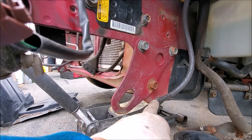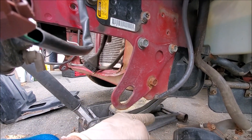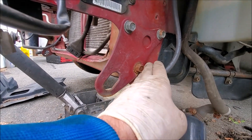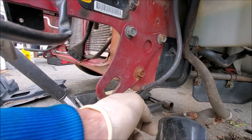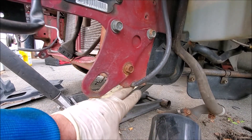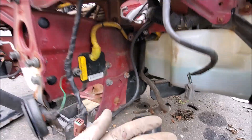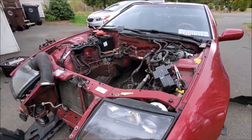Now, for some Z's where people say they don't have this connection here — if you don't have this, you will have this notch. The tube is just going into the frame rail, so all you have to do is use a self-tapper with a little clip to hold the line and you're good to go. That's it guys — a carbon canister delete. Hopefully you guys enjoyed it. If you haven't subscribed yet, hit that subscribe button, and I'll see you guys in the next one.